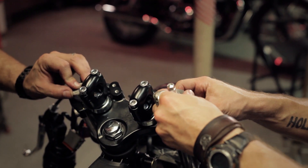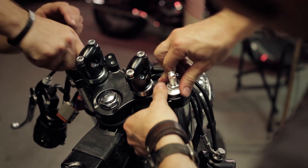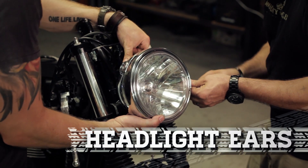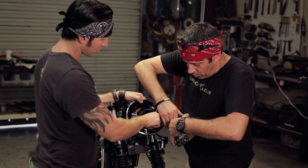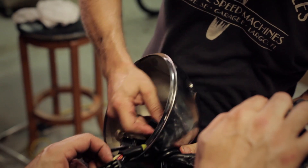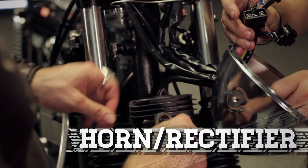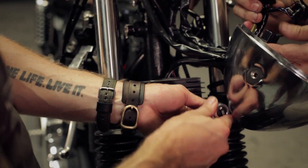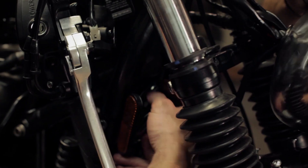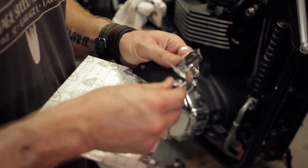The idea here is that we take our solid plate and that goes on there, and then the preload cap pushes on that. We've got all our headlight wires in. We're going to go ahead and remove our regulator rectifier unit — we have a really nice relocator from British Customs, a nice relocation kit.